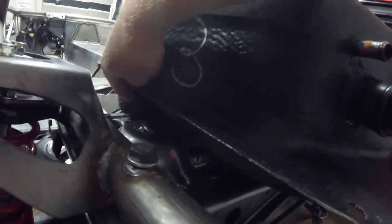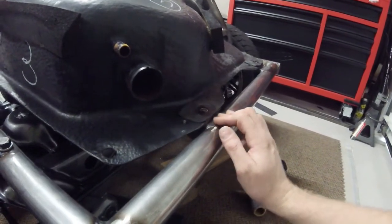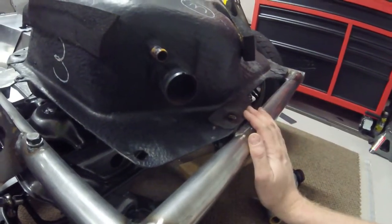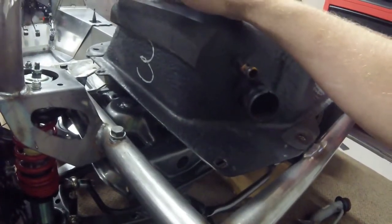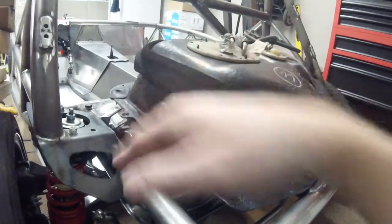You can see this large gap — that is because the sump hits the subframe there. So these mounts from X Motive are almost useless in their current form. You actually have to make mounts on top of them to extend the height of the tank up. The issue that causes is that you cannot get the proper pitch forward on the tank to fill it up all the way. Only about one to two inches of pitch is going to be possible and still fit underneath the bodywork.